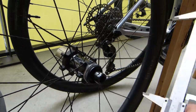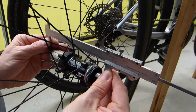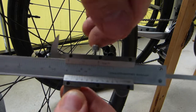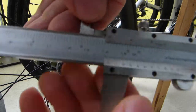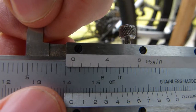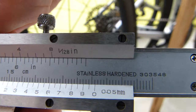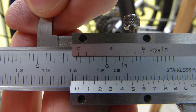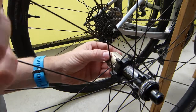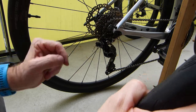So this, on this particular wheel, is 142 millimeters exactly. I could lock this measurement in, and yes, there are digital instruments, but they are usually shorter than this, and they don't span this distance. So that's 14 centimeters there and 2 millimeters. 142 millimeters, just about spot on. Now that's very fine. That's exactly the design frame width from the axle spar here to the other side.